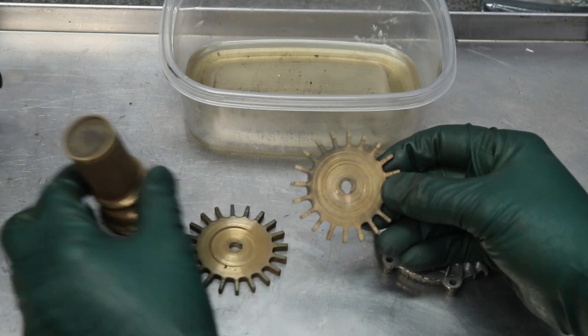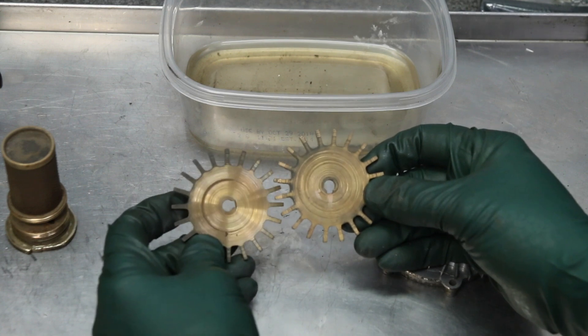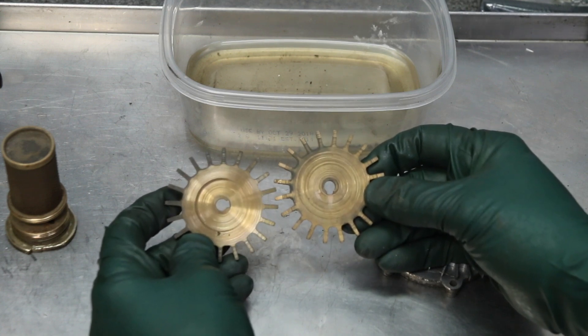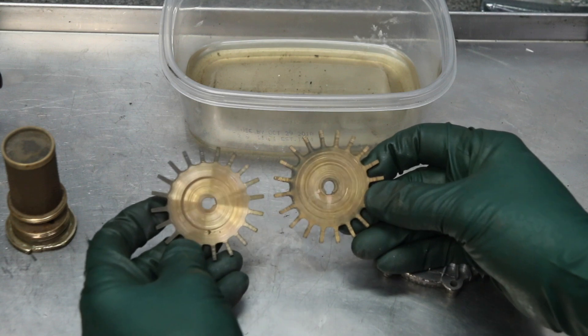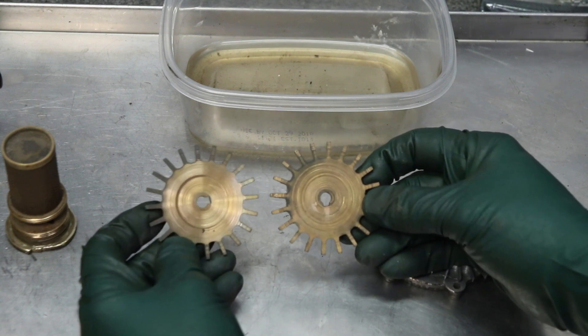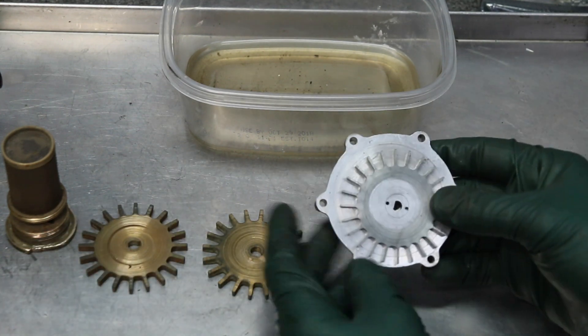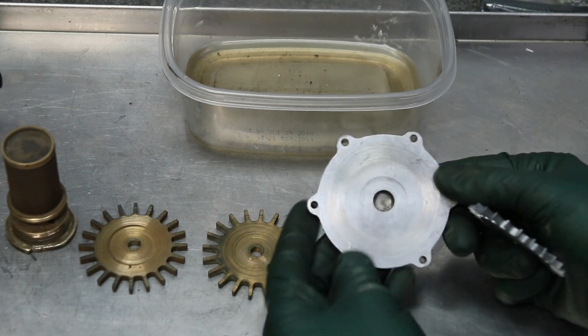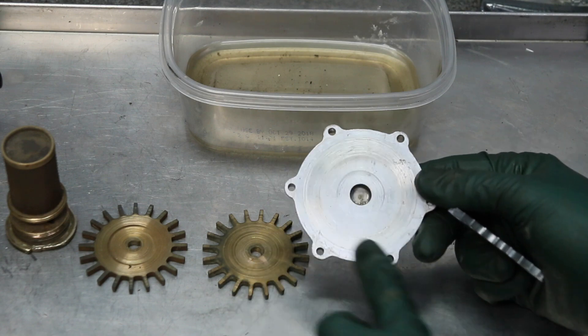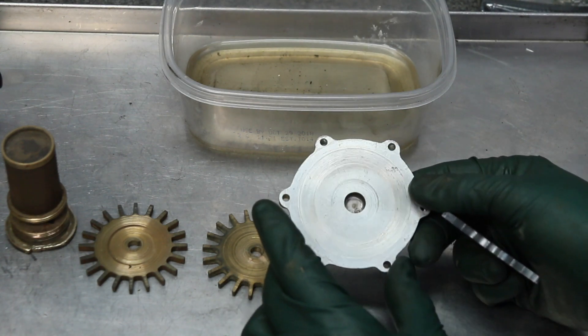If the tank screen is doing its job, metal particles should not be getting into the impellers on these fuel pumps. Look at the scratching — that's not caused by bad gas, that's caused by contaminants, probably metal particles. Here's one of the newer pump impellers with very fine scratching. What causes that? Very fine particles in the fuel that get by these fuel tank screens and cause damage to these fuel pumps.